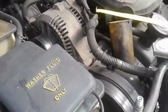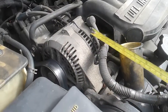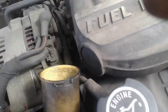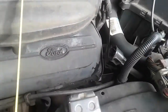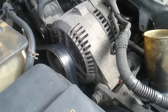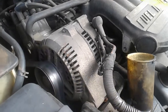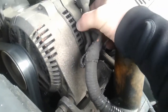This is probably the best I could find — it's an 8.25-inch ear-spacing 3G. It's definitely not very clean, and every time you buy a used alternator you're taking a risk. These are about $250 brand new. I'm going to get as much of the alternator cable as possible since the battery is over there. It's some kind of 90s Taurus — they also came in the minivans with the 3.8-liter. Get as much of this wiring harness as possible.